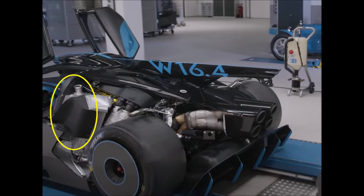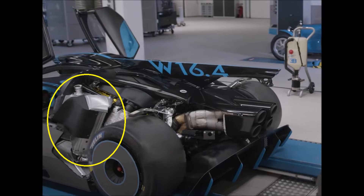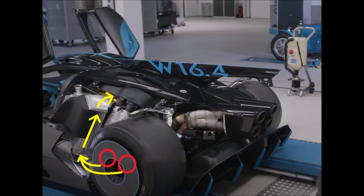This looks like an oil tank, which sits under the fuel flap in the bodywork. And here is the intercooler. The two turbochargers per side are sitting pretty low, so it's likely that the intercoolers are fed from below and the other connector is the outlet towards the engine.